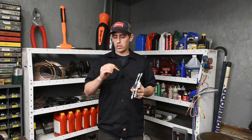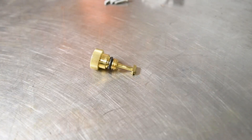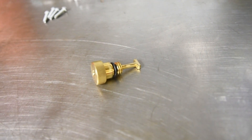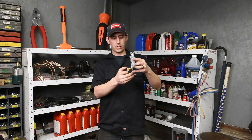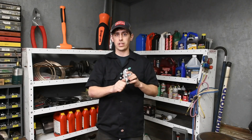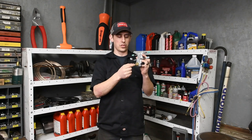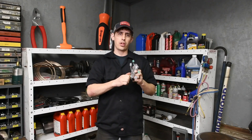Here's a nice little tip: this brass drain plug is actually a factory Ford part that came on the low cab forward trucks — the cab-over trucks with the 4.5 V6 Power Stroke. The nice part is when you loosen it, it just dangles so you don't have to worry about dropping it into a bucket. You can take it out without tools as long as you don't over-tighten it — it has a knurled grip. It still has a 6mm Allen port if you need a wrench, but you can just reach right in and drain your separator much more easily.